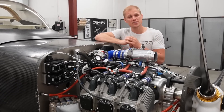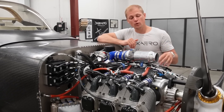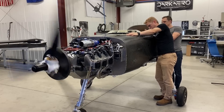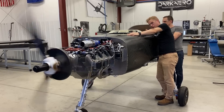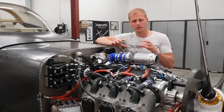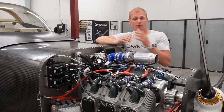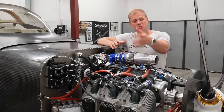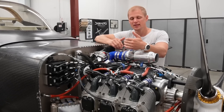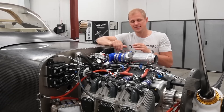Priming the oil system — we remove one spark plug from each cylinder and then turn the propeller and crankshaft over with just the starter motor. The idea there is just turning it over runs the oil pump and pumps oil through all of the engine systems, just so that we have lubrication everywhere. With one spark plug removed, it keeps the cylinders from building up pressure and loading up the bearings before there is any oil in the system.